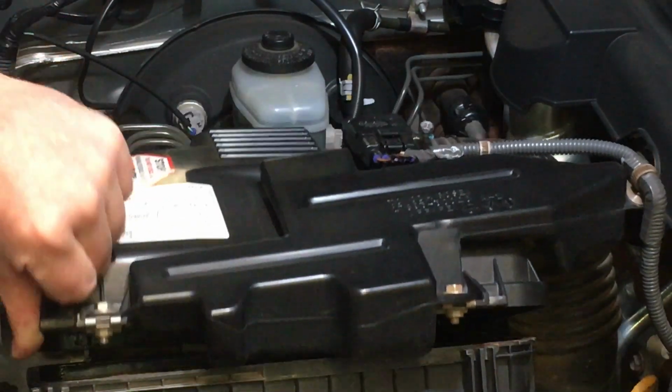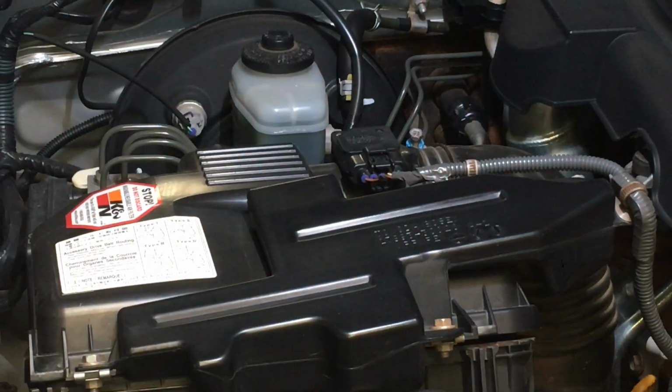The only dust that's in there is the dust that was in there before, when we were using paper filters, okay? So this is the way it works. The engine, this diesel engine, or any engine, is going to suck the air it needs. If the air filter's blocked, it's either going to pull it around the edges or through the filter anyway, and it's going to pull some dust with it. In my experience, once those paper filters become blocked, and they are quite good, the genuine Toyota ones seem to work the best on our vehicles, okay?